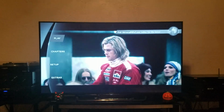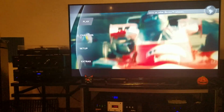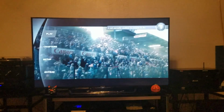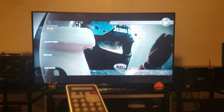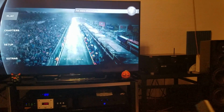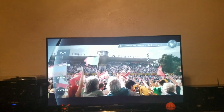I've got a Pioneer Elite Blu-ray player on right now, and as you can see, it's switching the audio to TV speakers. So we're passing through the audio and video right now from the Blu-ray player. I can do it once more. I can change it back to cable sat, but yeah, that's how you do it. So you just go into the video settings of your receiver, select which pass-through source, and there's a number of different settings you can change sometimes, such as the receiver turning off after a while, but that's how you pass through a source on your receiver.